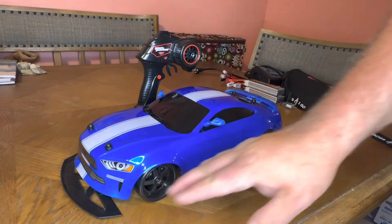There's going to be a screw here and here on the front, and a screw here and here. Once you do that, these will pop out. You have to put the two top screws back in because they help hold the front end together — so you'll have two spare screws per bumper removal, four total. The nice part is you can put everything in a Ziploc bag and return the bumpers if you'd like. Same process for the back — one screw here, one there, and two on top. You can actually just pop them in and out, which is handy.